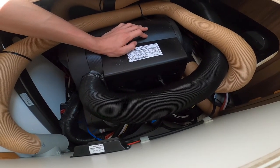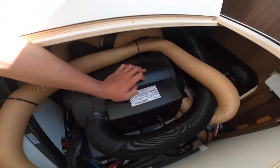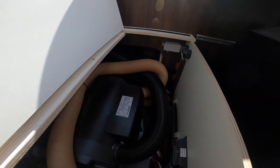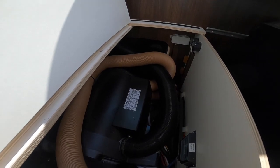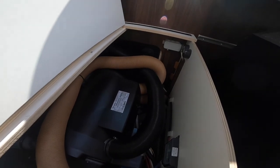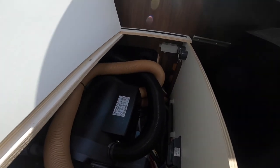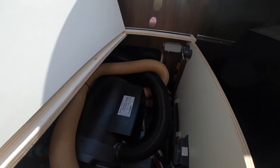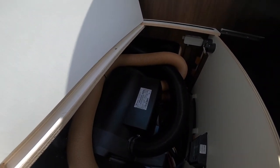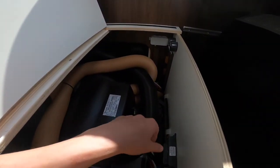fill the vehicle with water via a hose pipe, come in, put the pump on, go at the cold side of the tap first, you'll get automatic cold water through the tap, and then on the hot side, when you get a free flow of hot water, this indicates that the vehicle's boiler is pressurized. So don't be alarmed if it coughs, splutters. It's when you get a free flow of hot water from the hot tap, the vehicle is pressurized for the season. And then you would do every other tap, and it shouldn't take much longer.